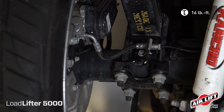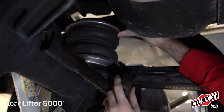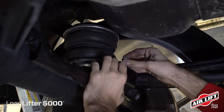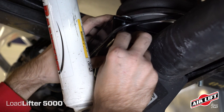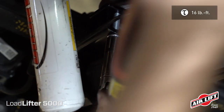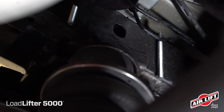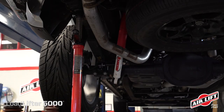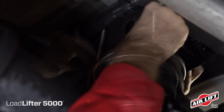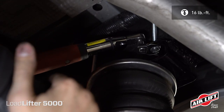Position the forward clamp bracket on the front side of the axle. Place the assemblies on the lower strike plate with the fitting side of the assembly facing outward. Align the tab on the forward clamp bracket with the hole on the front of the lower bracket. Insert two carriage bolts into the front and rear square holes of the lower brackets, align the front and rear clamps correctly under the jounce bumper strike plate, and thread flange nuts onto the carriage bolts. For trucks without a fifth wheel hitch bracket along the frame, place U-bolts over the frame on both sides of the vehicle. Lower the vehicle or raise the axle while inserting the threaded portions of the U-bolts through the corresponding holes in the upper brackets. Install flange nuts finger tight, then adjust the upper brackets to vertically align the air springs with the frame, and torque all flange nuts.